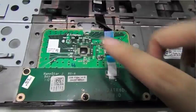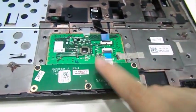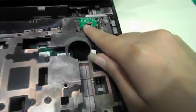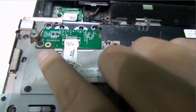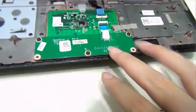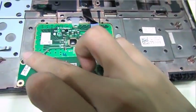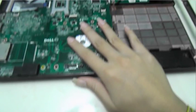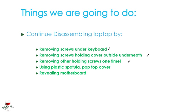As you can see here, there's the mouse. To remove the mouse, all you need to do is remove these three screws and then the connections. This connection right here is the one that went to outside. This you can remove by that screw. This is the power button, and then this is another screw holding those three little lights you see that turn on to your right of the laptop when you turn on the computer. Once you've done that, you just unscrew and put it back — I was just showing you so you know what to do. And basically, we're now in front of the motherboard right there. We revealed the motherboard — using the plastic spatula, we popped the top cover.